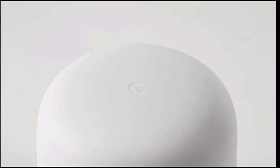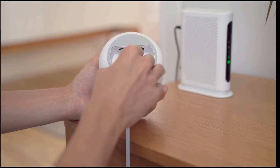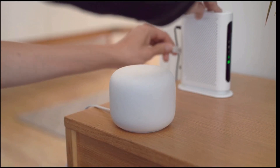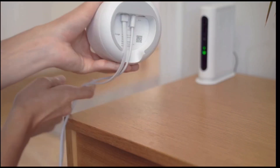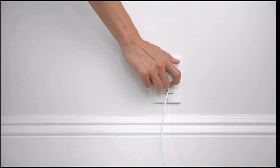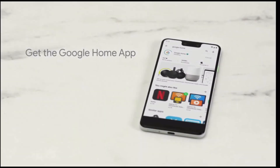You just want to follow the instructions that come on screen. But before you get deep into the app, you want to find your internet modem and then plug one of the Ethernet cables into one of these mesh Wi-Fi routers. Then power up by plugging the power cord and let it sit for a minute or two — you should see the light turn green.